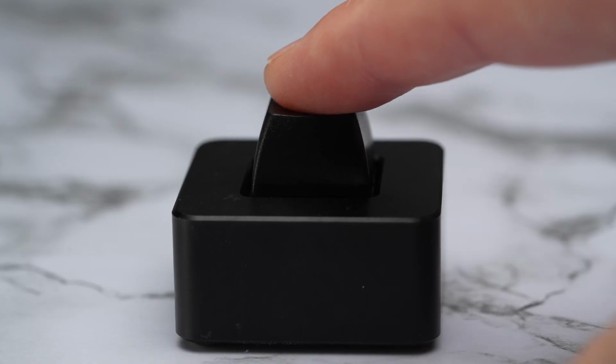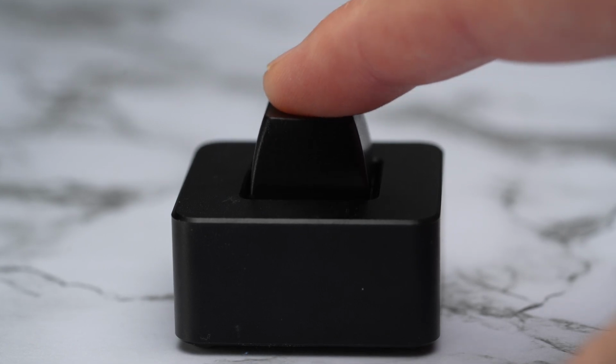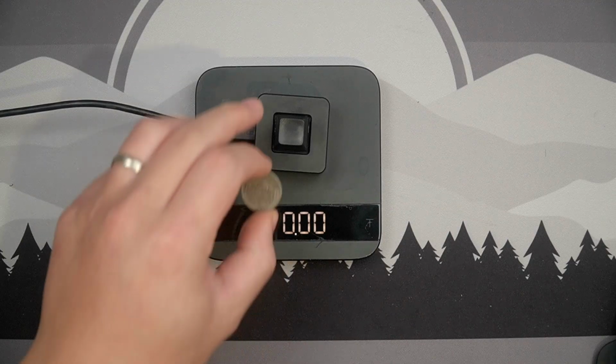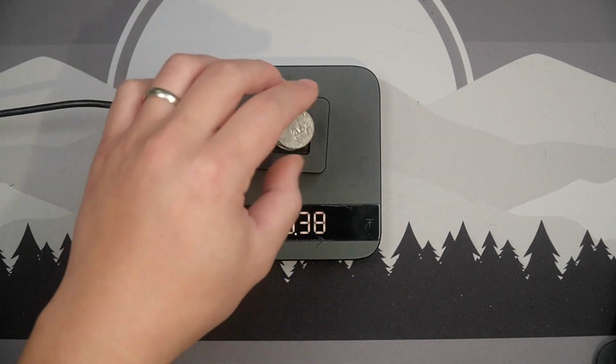There are two things that can't really be communicated well over a YouTube video, so I'll do my best to explain how these switches feel in my own words. First, these switches feel very snappy, probably due to the long 2-stage spring. They have a very quick actuation at what feels like the very top of the key press and a very heavy bottom out. In regular typing, the weight of these switches feels way heavier than the listed 65-gram actuation, although I've noticed that long 2-stage springs have a tendency to do that.